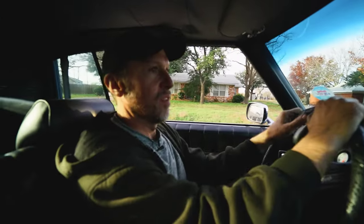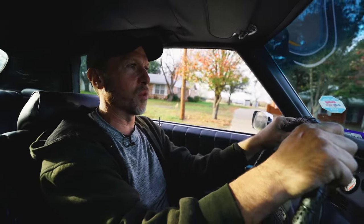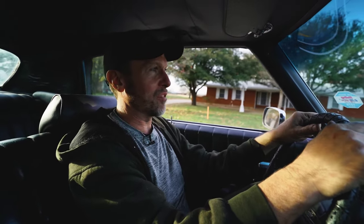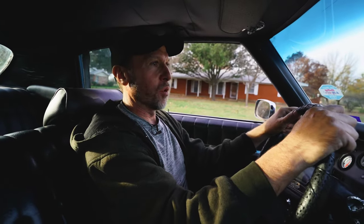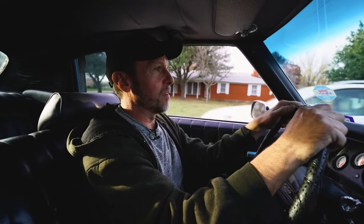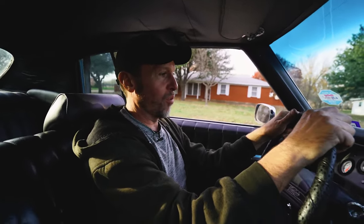Yeah. No danger of hitting nothing. No, and it's stock brakes all the way around. The only thing I did is I put Power Stop cross-drilled and slotted rotors up front. That just kind of helps with the brake fade if you do have to get on it kind of hard. They're nothing special. The rotors that were on it were shot, so yep. Just a little upgrade. But the rear brakes are all stock drums. Didn't even replace anything.